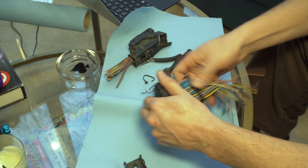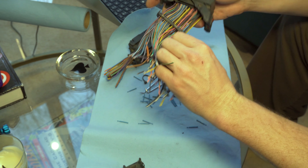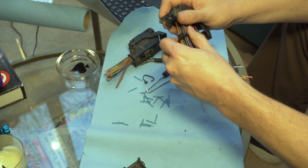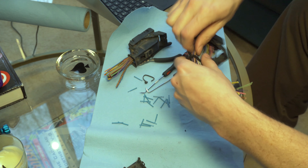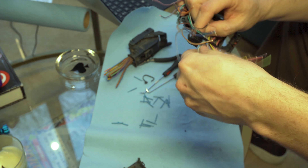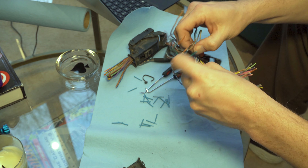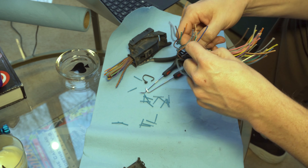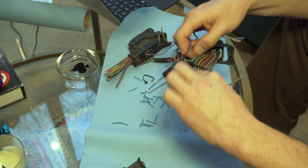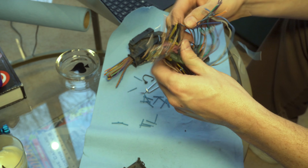Now she's coming apart. Turn it upside down and shake all the blue pin deletes out — set those aside and save them for when we start rebuilding the harness and need to fill empty pin spots. Your connector may or may not have these blue pins, so don't freak out if it doesn't. Some already have spots that are blocked off. Watch out for twisted wires in here — those are purposefully twisted, probably analog signals that need twist to cancel out noise.